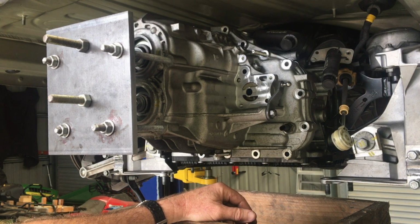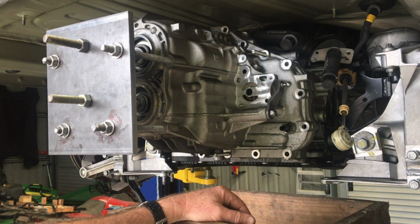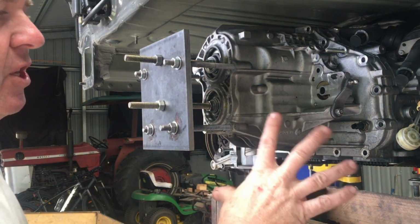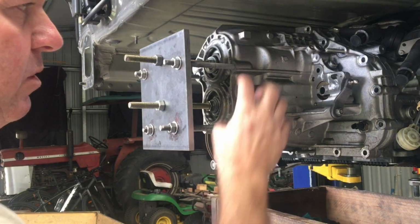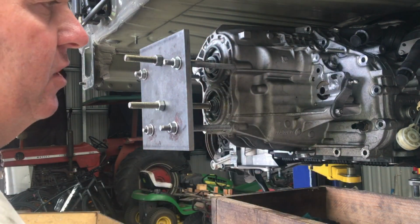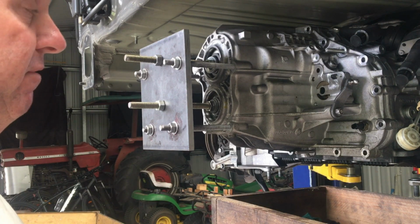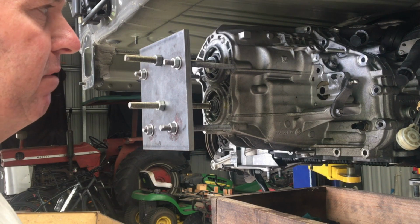I'm in the process of trying to get one 3D printed, the cage, so I could reuse one that I've already broken, but that is something you need to be really careful of. One thing also to be aware of when you first start to move the shafts out of the bearing: because they are a dry contact surface, they will give this really large crack, and then they will creak as they move out. That first large crack can be quite disconcerting, so be ready for that.